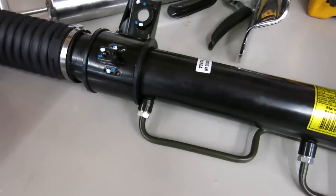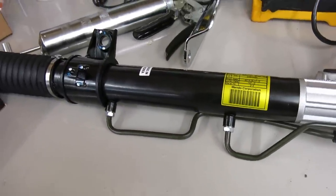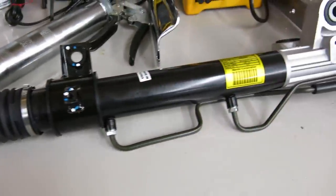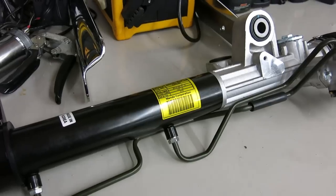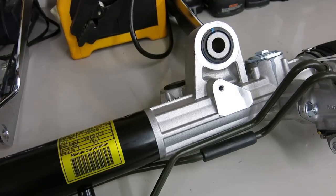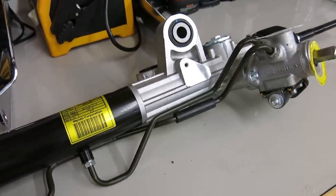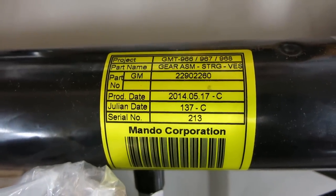The parts I have so far include the steering gear replacement. I believe that around 2012 GM actually redesigned the steering gear internals and changed some of those parts, and that the 2012-on part number is a better one to use than the one from 2008. On Rock Auto you can get rebuilt 2008 steering gears for about $175, but the brand new AC Delco part is $335 and cross-references against the newer Lambda models. That's the one I have here today — the $335 brand new GM part from Rock Auto, part number 22902260.